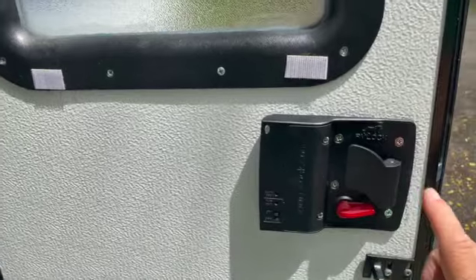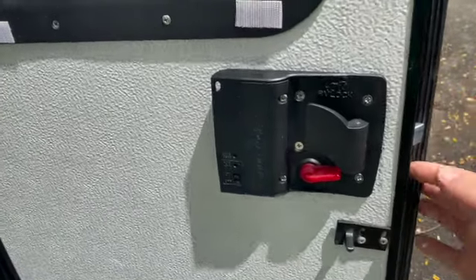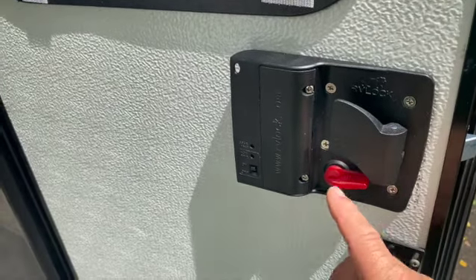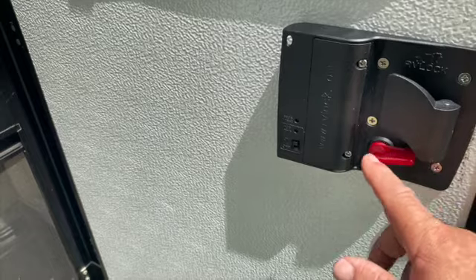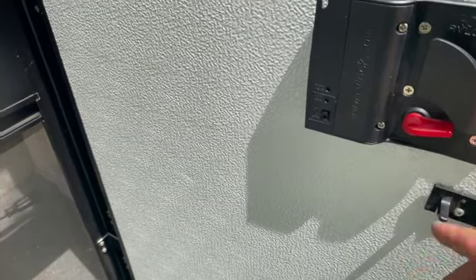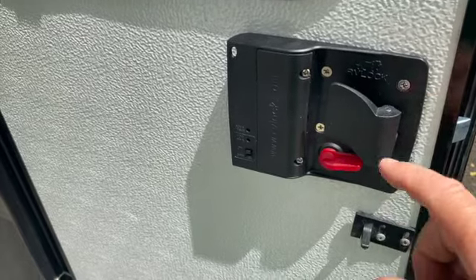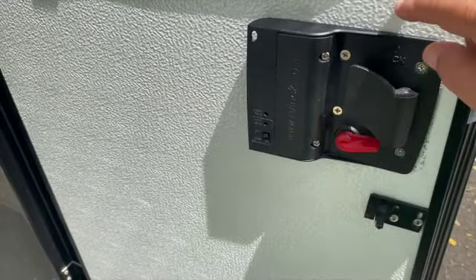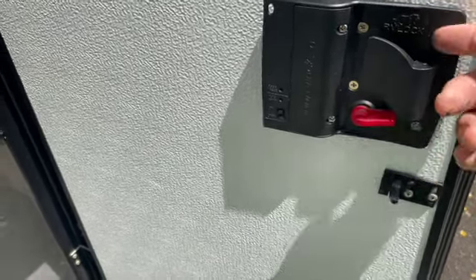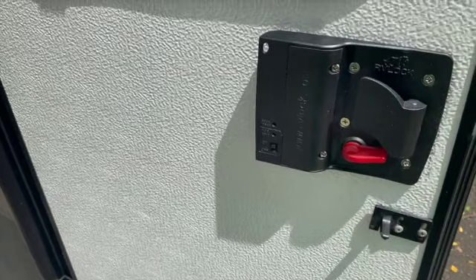There's the inside piece, and you can see it's just a little bit tilted. But everything works and everything's fine, no problems right now. I may try to figure out how to fix it — there's one hole that has to be a little bit further down or a little bit over. I could just re-drill it, because this is a metal covering over a foam-insulated door, so I'd have to kind of trim things out a little bit if I want to do that.